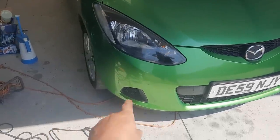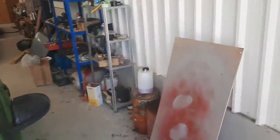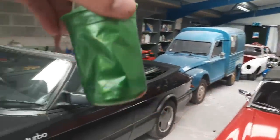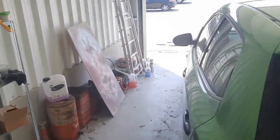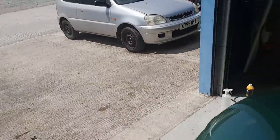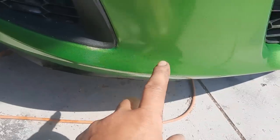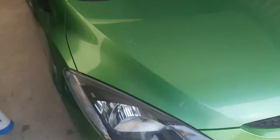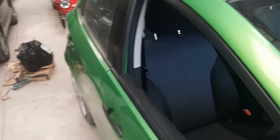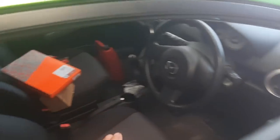I've got to get David to paint a bit down the bottom here that was scuffed, but luckily he left me some paint yesterday. I've actually managed to paint it with the paint he had left over - I know someone who's going to be very pleased about this, Royston. I set up my compressor and used the gun with just a little bit of paint Davy left me. I had to use a can of lacquer afterwards because I didn't have any for the gun, but I put the pressure nice and low, kept it localised, and the colour match is good. I need to buff it off still but my metallic matches the rest of the green quite well. This is going back down for MOT tomorrow - the brake pads, discs, oil, and air filter are there so they can do a service at the same time.